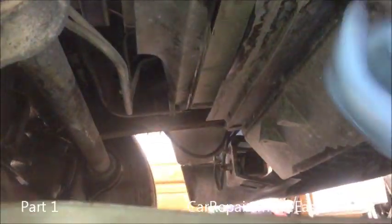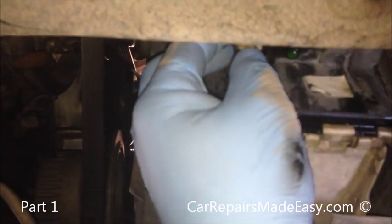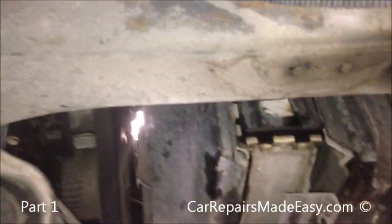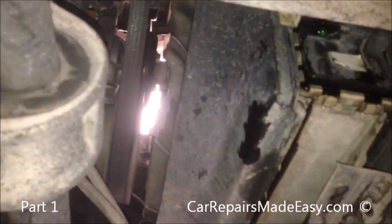The first thing you've got to do for this job is drain the radiator — the cooling system — here at the petcock, which is right up here. This should just take a quarter or half a turn if it's not messed up and it doesn't want to come out. This is where you would want to drain it. It's plastic so I really don't want to put pliers on it unless I have to. It doesn't want to come loose.